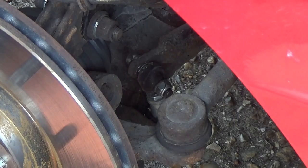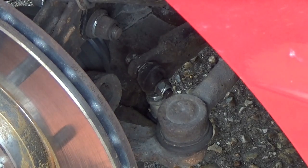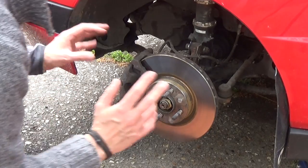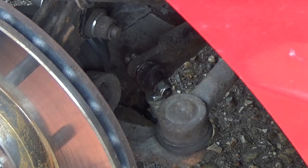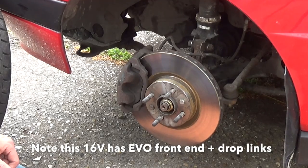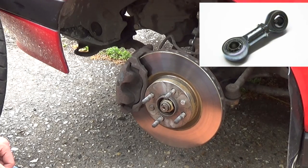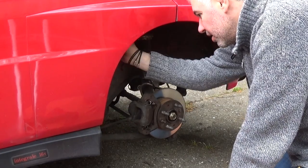Also make sure you keep an eye out on the various suspension bushes, which tend to go — the standard ones after 20–30,000 miles. If you have a clunking noise at the front of the car, the most likely culprits are those roll bar drop links, which look quite cheap. They're rose-jointed — you can get some cheaper ones for about £60, but any decent ones go for about £140–150.